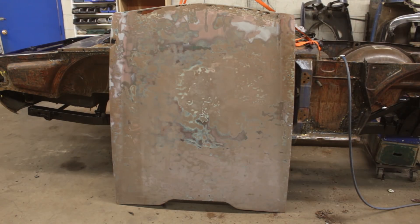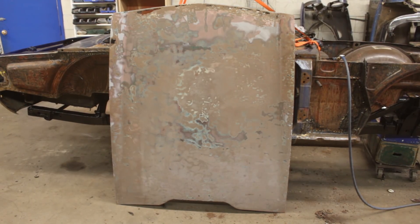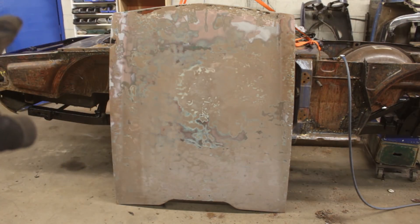What do you see here? A TR6 hood. A TR6 hood that is not worth anything because it's all rotten. But for me, that's about 10 square feet of solid 18-gauge metal. This is what I'm going to use for the little repairs now because I don't have any 18-gauge metal. I can use pieces of this hood that came off a '73 TR6. By the time you fix the leading edge and the holes over there, that thing is going to warp so much you'll never be able to make it flat again. Plus it's been sandblasted, so it's not good for a hood anymore, but it is good for repairs.